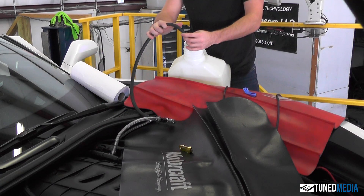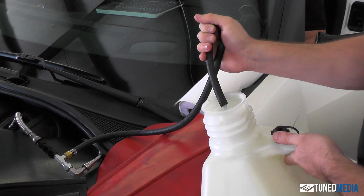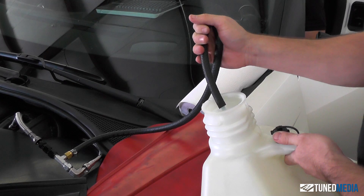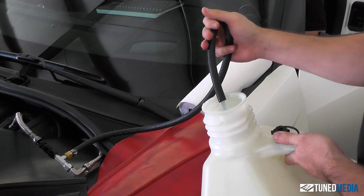We started by completely draining the tank — it's the same car obviously as last time, a supercharged C7. We're going to use that car for all of the fuels. The standard vehicle and the dyno, everything is exactly as we left it. What we've done is drained the tank completely to the point that it was dry, and then we put in a couple gallons of MS-103. The idea behind that is we expect to see some power differences and we're trying to see where it really likes to be timing and air-fuel wise.